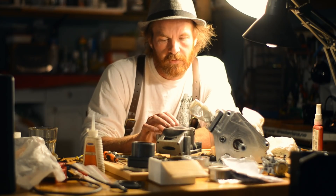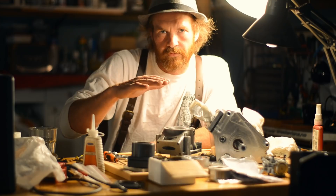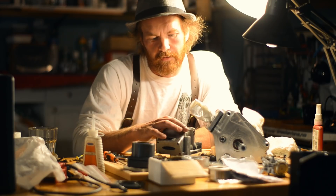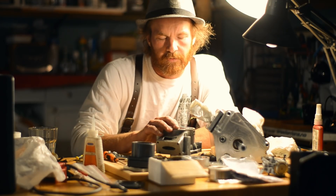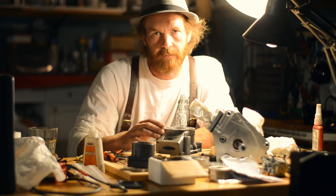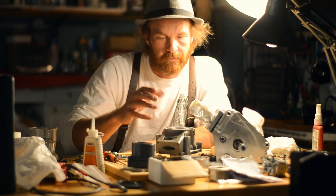Why no bridges in the exhaust? If you analyze any modern good racing two-stroke, you'll find that it is blowdown restricted. Blowdown is the area of the exhaust port above the transfers — the part of the exhaust port that is open before the transfers open. And it's crucial. It's easy to get enough transfer area; you could always just raise the ports, but then you will eat into the blowdown, and you can't just raise the exhaust port. The further away you go from about 190 degrees duration for the exhaust port, the less your pipe will be in resonance. The pulse from the previous cycle will be less matched with the pulse from this cycle.